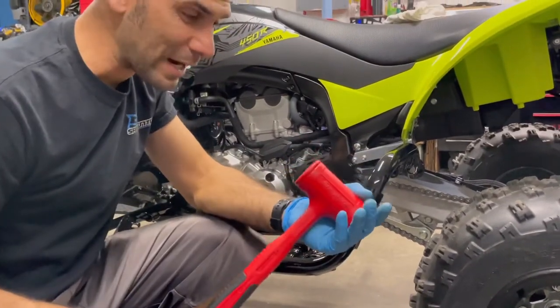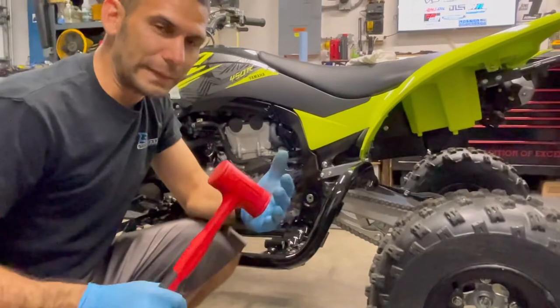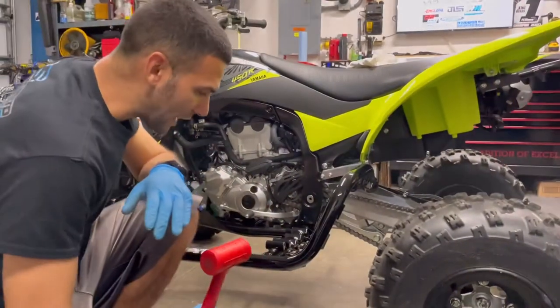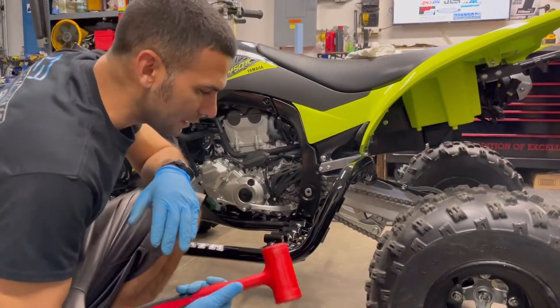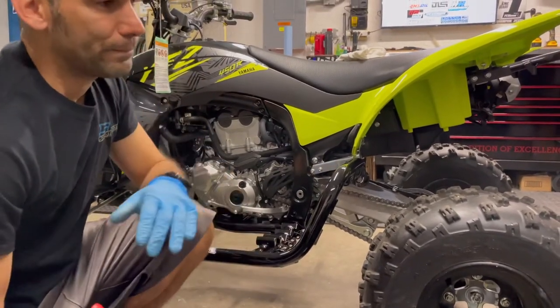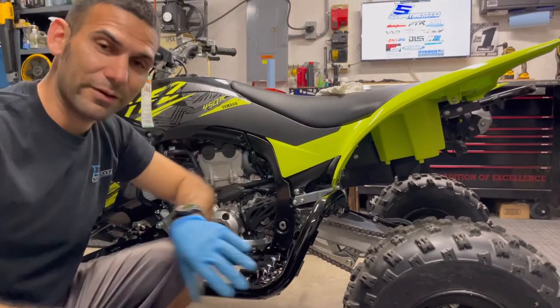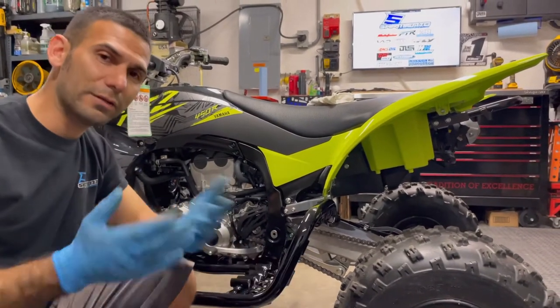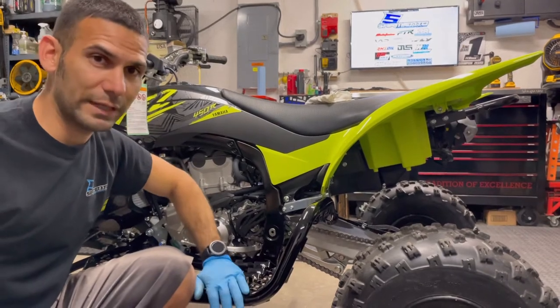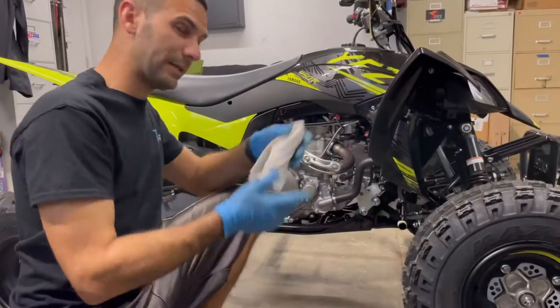If you have to give it some love, use a good plastic or rubber mallet - not a snap-on, but I use what I've got. Don't hit it crazy hard, because remember that starts to mess up your powder coat. It may not mar it visibly, but that's a spot where you actually start to crack the powder coat underneath. If you can avoid it, try to avoid it - that way your finish lasts longer.